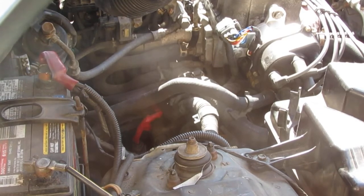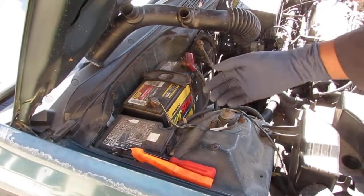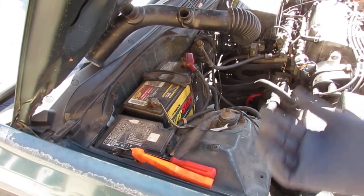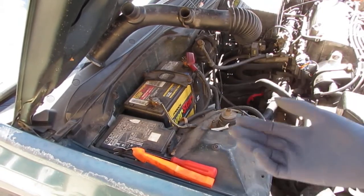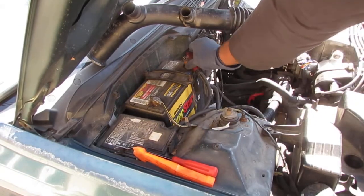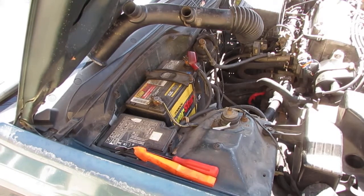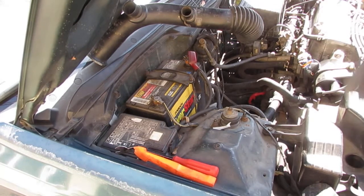Okay, another thing you want to do is check the battery. I already knew the battery was fine because I can tell from the behavior of the horn, the windows, and the lights. But you want to just check and see if your cable is loose. They're not. So we're good there. So we got a good starter. We know that the clutch...